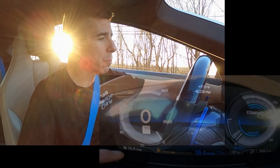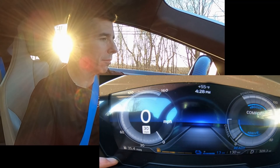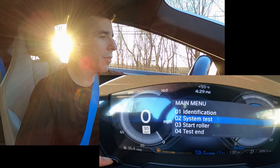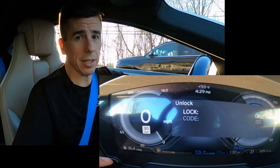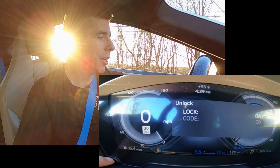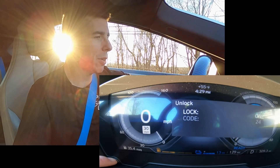The first thing we need to do is press and hold the trip reset button for about 10 seconds and then we'll get to see our service menu come up. Now if we momentarily press until we get down to unlock, we press and hold for three seconds and it prompts us for the code. That code is the last five digits of the VIN added up. So we're going to press this 24 times in my case — there's 24. So I'm going to press and hold for three seconds.